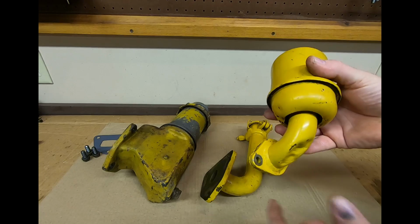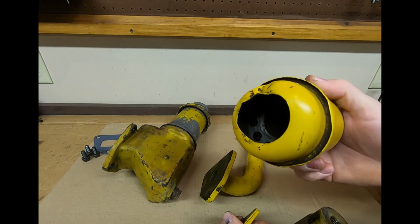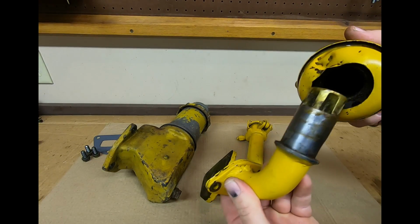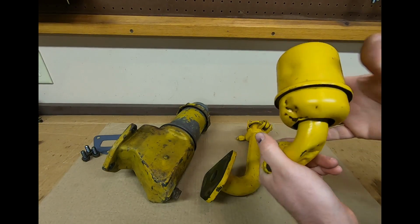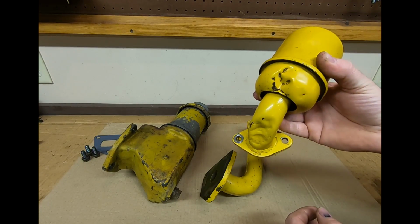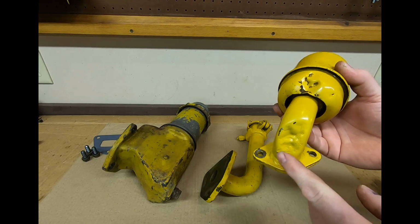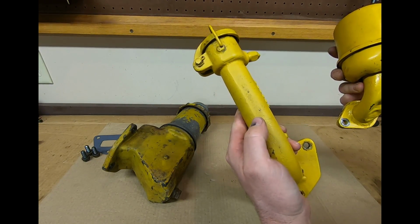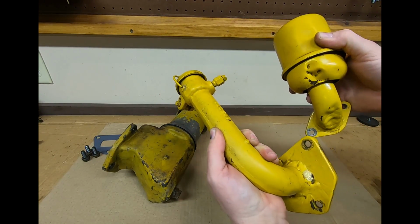assembly right here. We just have a stamped steel crimped together can. There's a bit of a media element inside of there. Vapors would come up that tube, enter into the can, and any excess would just vent out the bottom and exit out into the atmosphere. Well, being another 2115 piece right here, you can see, of course, they beat the heck out of this thing. I'm pretty sure that threw a track at one point in time and really damaged everything that was on the side of that engine. But we'll go over to 1113's block. I'll show you where these updated pieces ended up going.